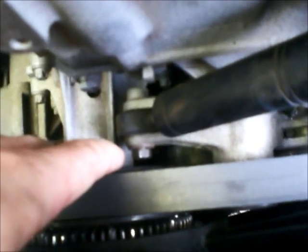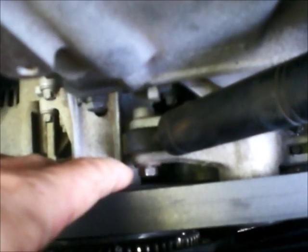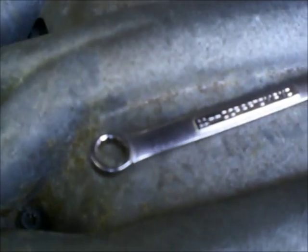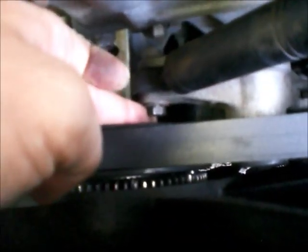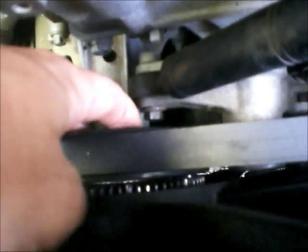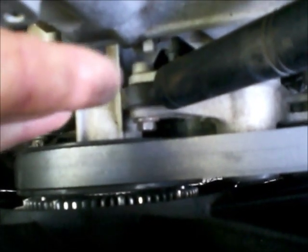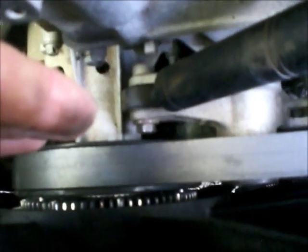The top bolt, which was right here, takes socket number 13, and the bottom one down there looked like 10 but shockingly it's 11. You don't use 11 much, but it's definitely wrench 11. I was able to loosen it, and now let's hope there is enough space to drive that bolt out and lift the shock out to put a new one in — a very easy and fast install.